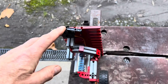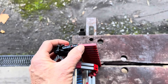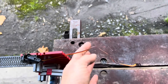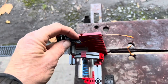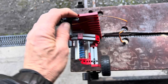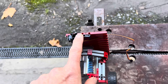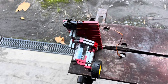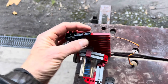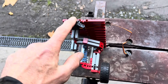Logged into the diagnostic tool you'll see something called height settings. Attached to the control arm is a little servo, and when you move it up and down it generates a voltage through the wire that tells the computer exactly what level the unit is at. Those voltages have to be within a certain range when you come to calibrate your car. Now, these little servos do different things on different sides of the car.